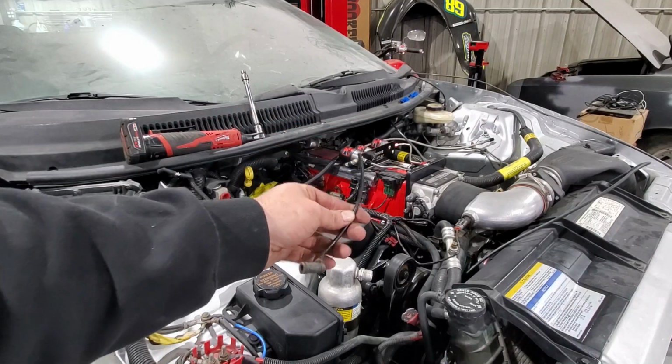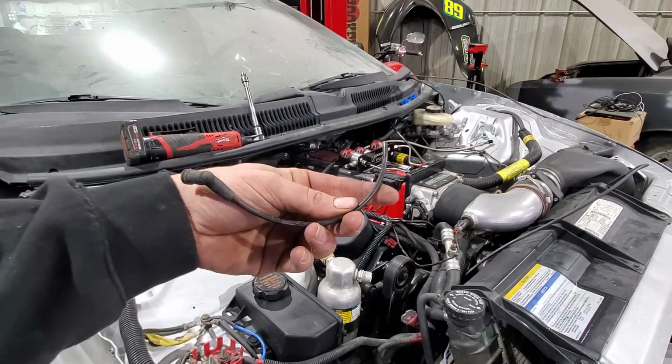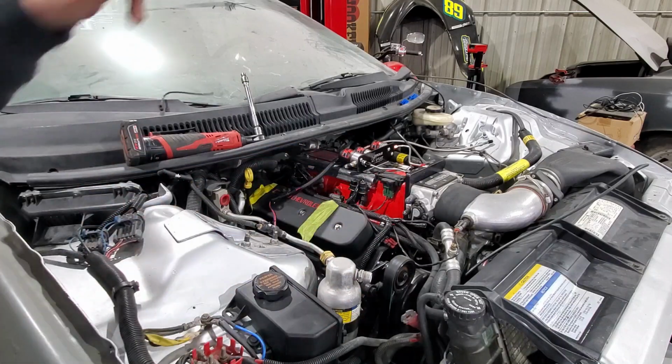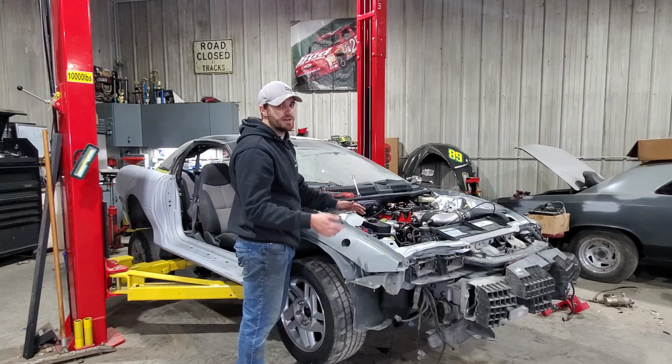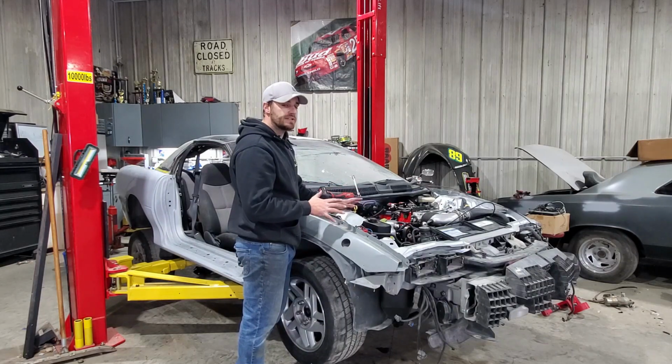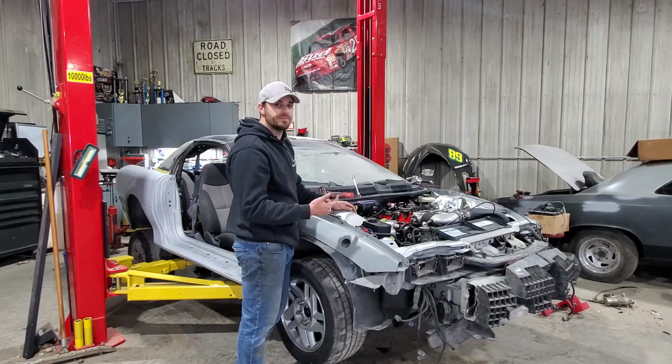That kind of sucks, as I was putting it in, the fuel regulator line, our vacuum line broke too, so we'll replace that in a bit. So fuel rail has been off. We've flushed the injectors, flowed them, they're all equal, they're all working. Fuel rail's back on, everything's tightened up, fuel lines are back attached. So what we're going to do now is raise it back up.